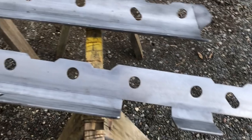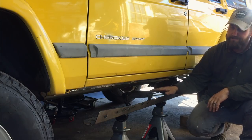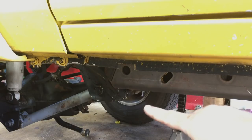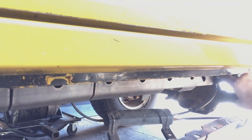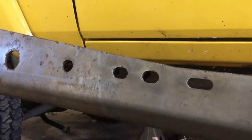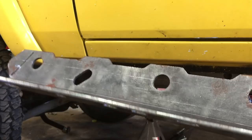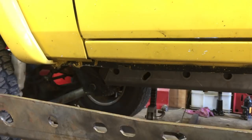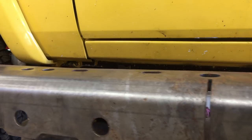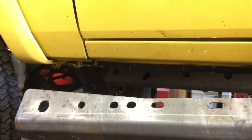This is a piece of 3/16 inch plate that is formed to the shape of the frame. It goes between the lower control arm mount on the front and the front of the leaf spring mount in the rear. It's all punched out and formed to the holes and contours of the frame underneath there so it's a nice tight fit. It's also got a couple relief areas where it will bend as you install it to match the contour of the frame even better.